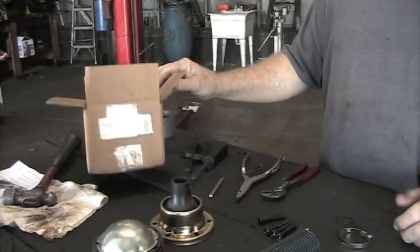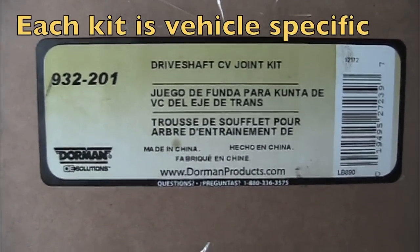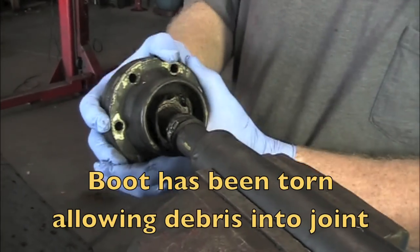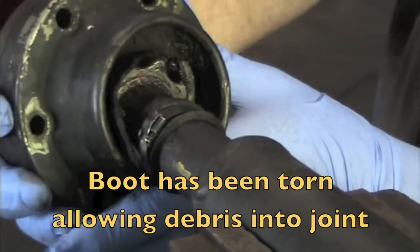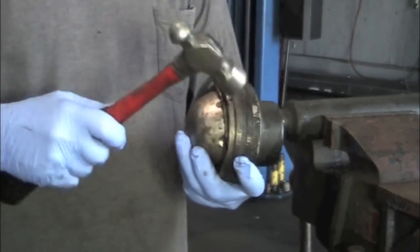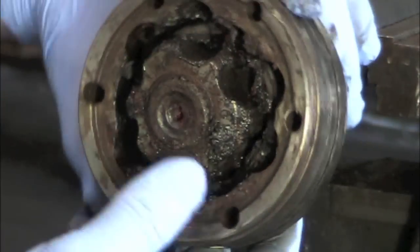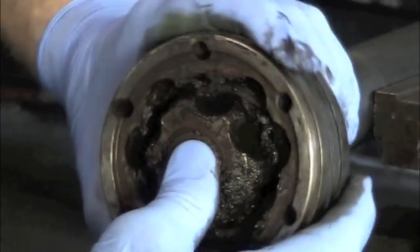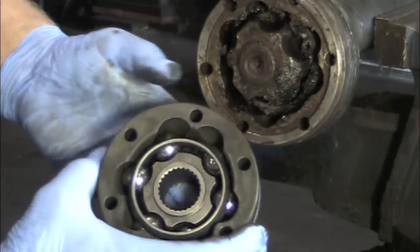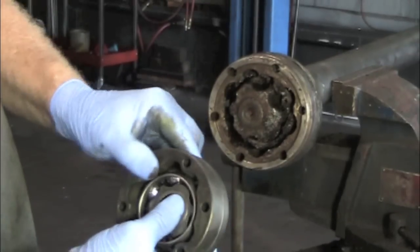Dorman's got a kit in the box that comes with these components. As you can see, this boot's ripped open, this joint's not moving very freely, and it's kind of gummy and rusty. Up in this joint it's all gummy, nasty — lots of dirt, debris, and rust over time. There's obviously a big difference between being able to see the components with the rotating balls and swivel head with the new versus the old.